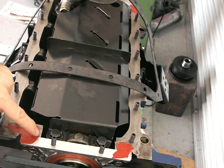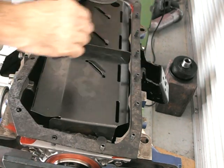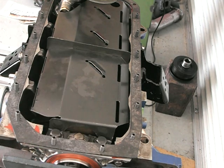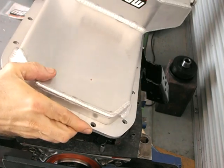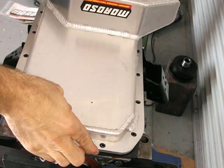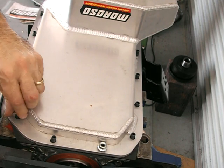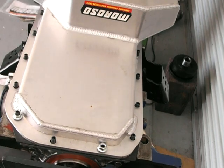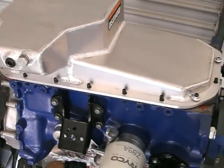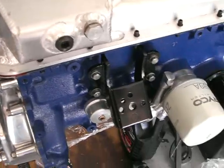That oil pump just has one bolt holding it. You can see the studs I've put around the base there. Put a bit of sealant just on the joins front and rear. That's an OEM gasket — I personally don't like aftermarket sump gaskets for these engines, so I went and bought an OEM. It seems to be much better quality. Put that on, get the Moroso sump, wiggle it into place, tension it up, and we are looking very good. The next stage will be putting the alternator and the belts and so forth on, plus the water pump. I'll make another video when I put the head together — that's probably the next major piece of work — and it should be pretty close to putting it in the car sometime soon. Stay tuned and the next video will be out soon.